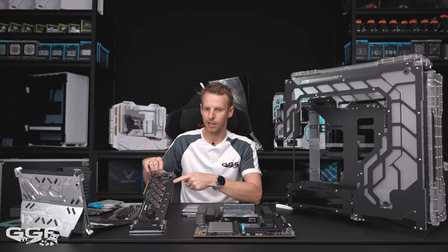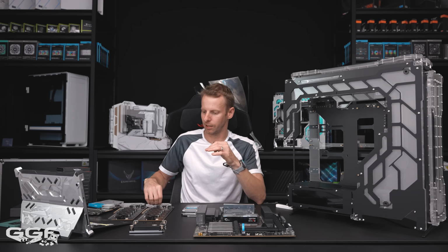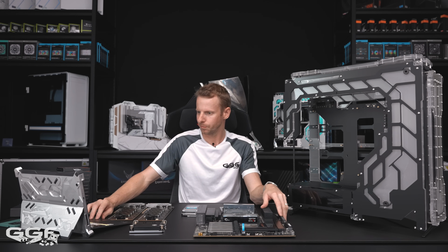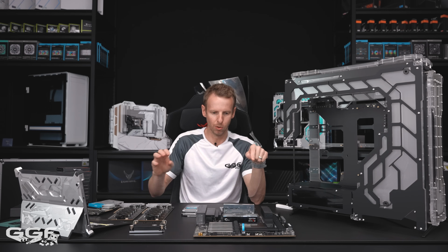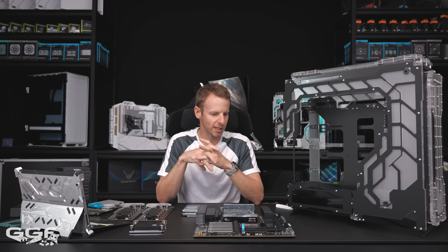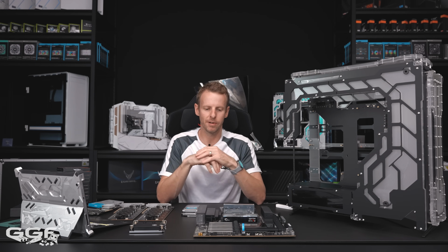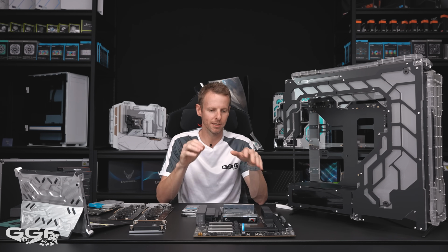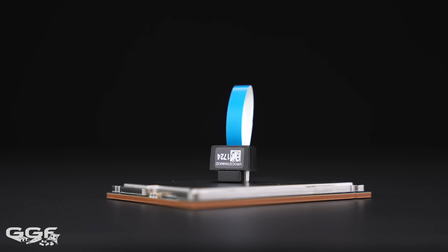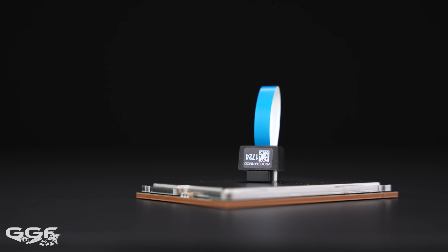Something like that is what I was getting with 4 of these in RAID 0. Now, another thing with this board is there is no RAID by default. The only RAID by default is via SATA, or if you have Intel SSDs. So basically what you need is this little VROC key, which is the RAID on CPU.